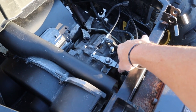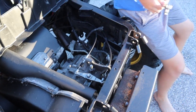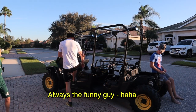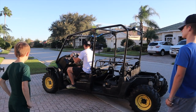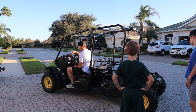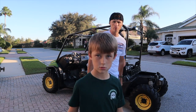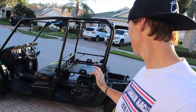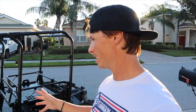This is the lever that we connected the transmission cables to - that's the nut that I tightened up. We're going to loosen it a little bit. Well, it's trying to go into gear. We have to do some troubleshooting. It's trying to at least do something, which is better than it was, but it's very hard to get into gear and you can feel it kind of slipping. So it may actually have something to do with the clutch. That or messing with the tensions on the transmission cables. I'm going to troubleshoot.